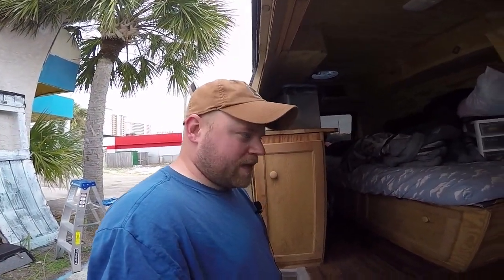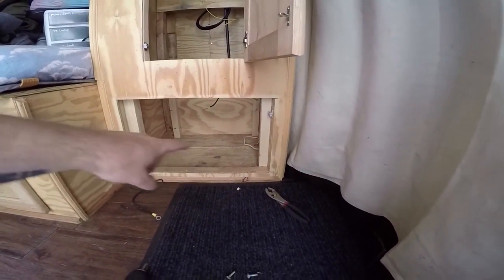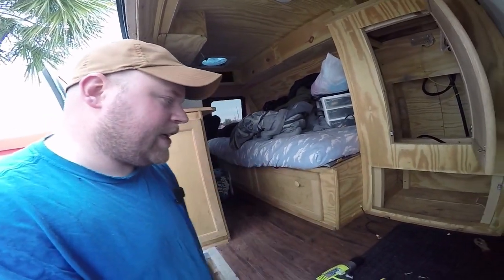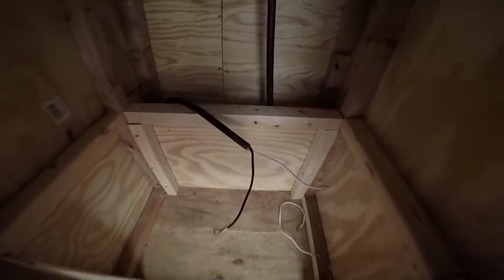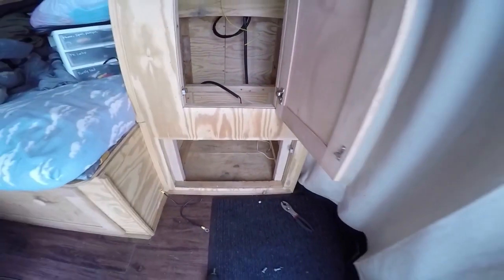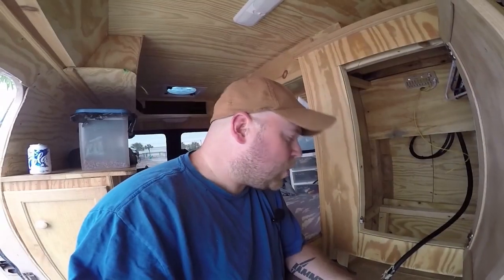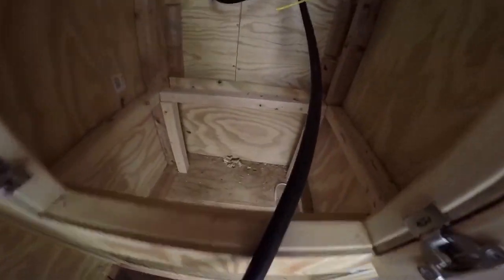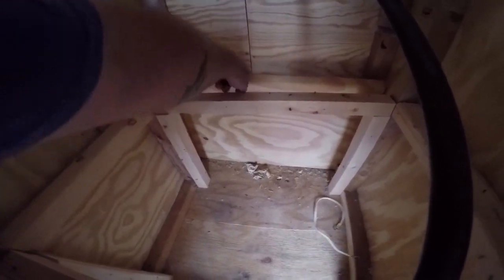I took some measurements of this compartment down here where I took the old batteries out. Width-wise, believe it or not, I have a quarter inch to spare to hold all four batteries in a line in that space. The problem is it's not deep enough. So I've taken off the front cupboard here — I thought about extending that out, and then I realized there is a false back built into there. I pulled it out — it's just a small piece of finish wood meant to enclose that area. I popped it out and I'm gonna put it in a new spot and tack it in permanently.